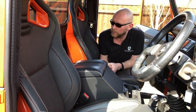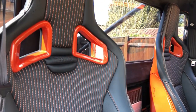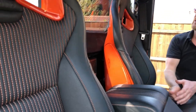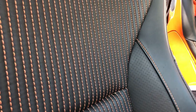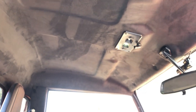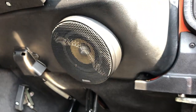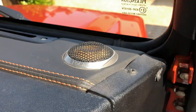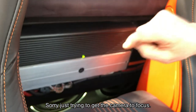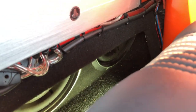Inside it's got custom Recaros — we bought a new set of Recaros, removed the lever, and had a custom trim job done by B-Trim in Enfield. Fantastic guys — they came up with the stitch concept and it all looks incredible. It's also got an Alcantara headlining and mood interior lighting. The hi-fi system is a three-way set of components: a woofer in the bottom of the door for mid-bass up front, a mid-range, and a tweeter — all made by Focal. We're using a JL Audio 1000-watt five-channel amplifier to run the entire system, and it also runs three 10-inch JL Audio subwoofers in the back, firing through an aperture nicknamed a blow-through.